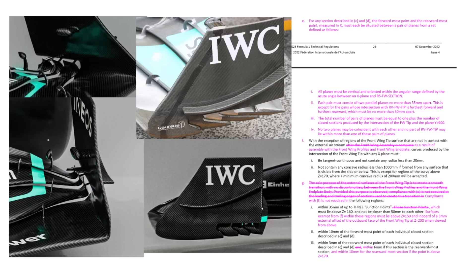One other detail you may have missed is that they didn't just stop at disconnecting the elements from the end plate — they went one step further and actually put in a tiny downwashing vane in this particular region. It's pretty hard to spot because it's very small, but you can see there's just this tiny little downwashing vane here. That downwashing vane should spin a vortex off it in the same rotational direction as the vortex coming around the corner, giving co-rotating vorticity that increases the overall strength of the vortex system. Because we've added a little bit of downwash here, we should get a little bit more pressure underneath, which should increase mass flow outwards and also increase vortex strength — a larger delta P around the shedding edge drives more circulation.